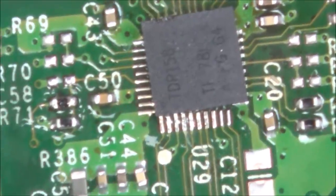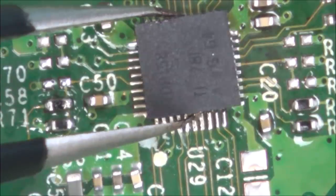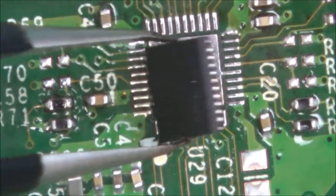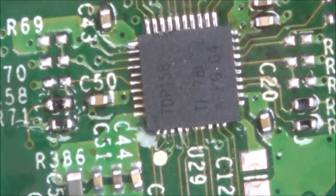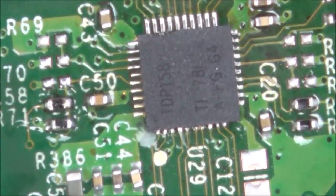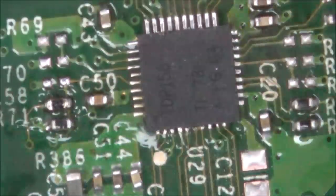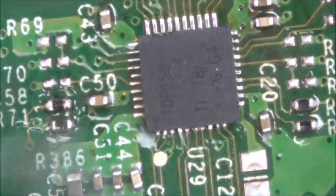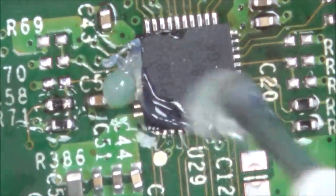Okay, and again, we're in the right orientation. So I'm not going to take any solder off or anything like that. Let's just do it, hopefully now, because there's leaded solder on the board still. I'm hoping this will go into place okay. Again, let's add lots of flux. That came off really easy that time. Nothing like the first time I did it.